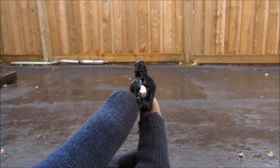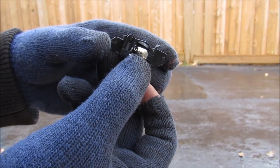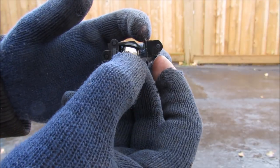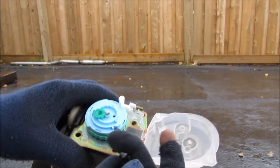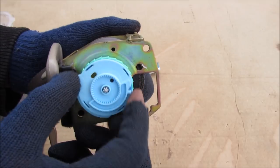I'm going to remove this gravity ball to show how it works. You can see that when the vehicle is decelerating, this tooth here is actually going to move upward. And that's going to engage with the splines on the shaft here to lock the retractor in place when the vehicle is rapidly decelerating.